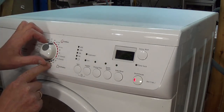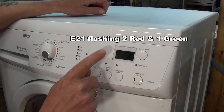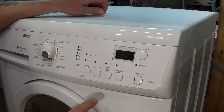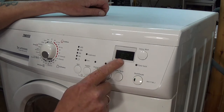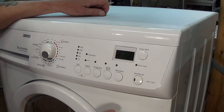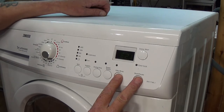This is now showing E21. On some Zanussi machines the appliance will flash a sequence of lights if you do not have an LED display. Here you can see two red lights flashing followed by one green — the two reds relate to the first number, the one green relates to the second number. This tells you your error code sequence. To clear the error code you need to press again Rinse Extra and Pause until the LED starts flashing and E00 appears.